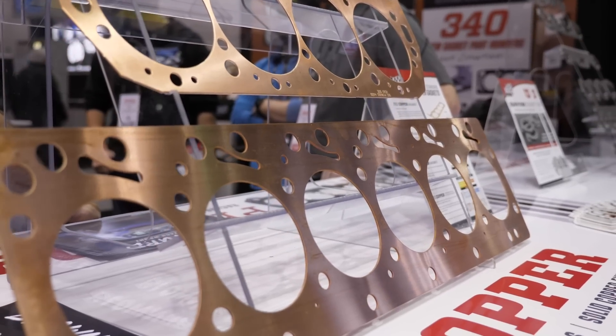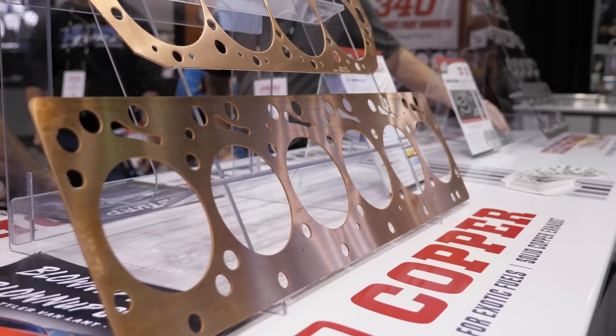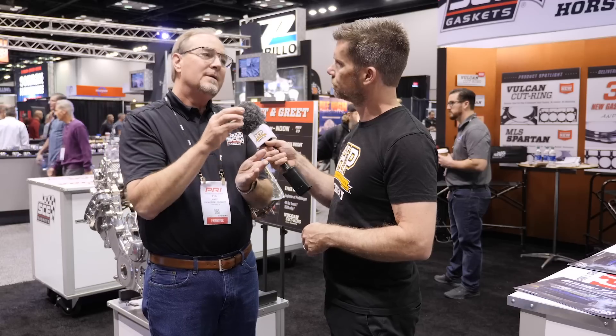Copper head gaskets are really suited only for billet-style blocks without coolant, because copper is not well suited for coolant and oil sealing — they tend to weep when the block and heads are cold. On a street car sitting in a cold garage, you might see coolant dripping on the floor. Unlike MLS or composite gaskets, copper has no memory, so when things are cold and shrunken up, cold sealing is not there. A top fuel engine develops on the order of 15,000 psi, whereas even a high performance street car is in the 1,200 to 1,800 psi range — quite a different world.